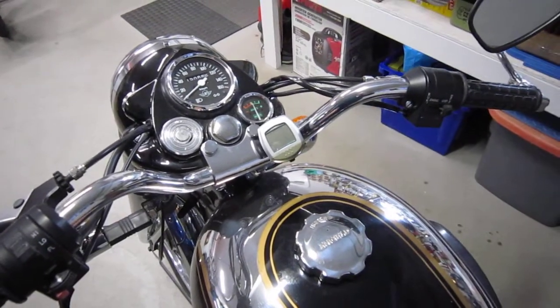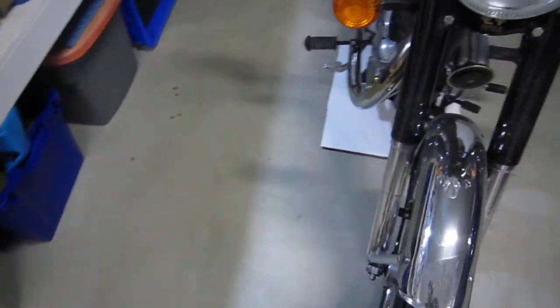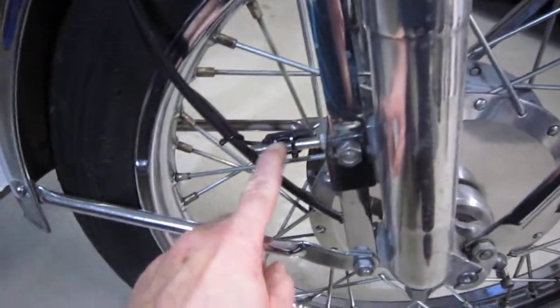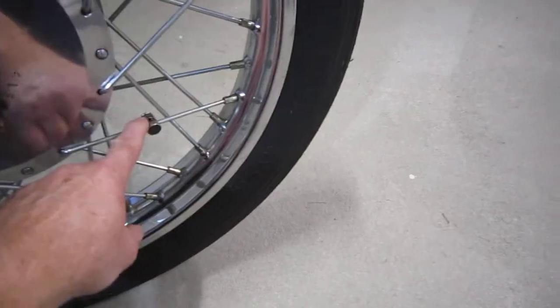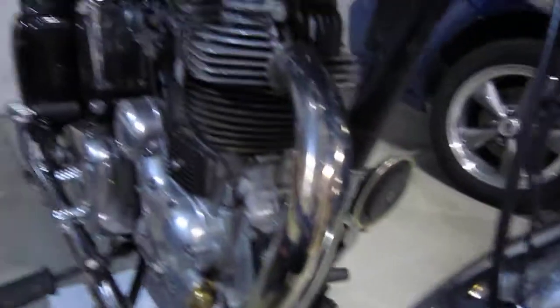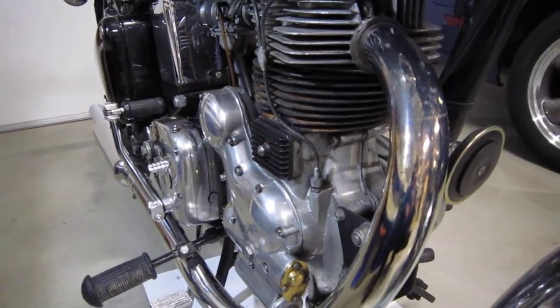Years ago I put on one of these bike speedometers — this is what I use and it's dead accurate. You just measure the circumference of your front tire, put the reading into the bicycle speedometer, and you get an exact reading of your speed. I just put a bracket into where the mudguard stay goes, and the sensor is wired onto the speedometer cable. There's a little magnet — it works by Hall effect, just goes by the sensor, and every time it passes it reads. Anyway, that's what I'm going to be doing this year. I just thought I'd do this little intro video and the next one will be me getting into tearing this apart and seeing what kind of shape the inside of the engine is in.